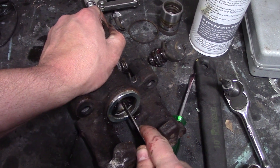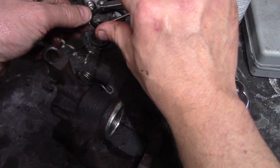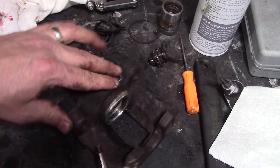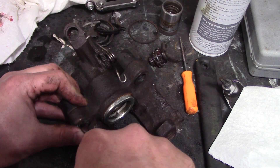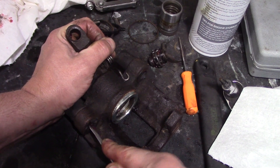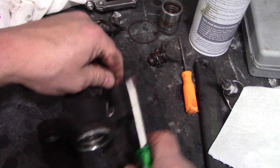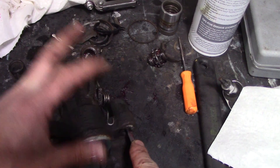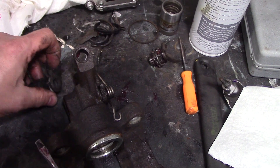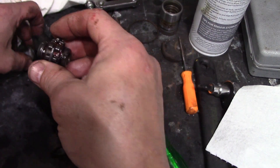Get the square seal out — there's a square seal; it's the only one in the brake cylinder, right there. You can also push out the boots for the caliper pins if you want. The easiest way to push them in and out is on the flange side — that's the toughest part of the rubber on these things. So let's clean this stuff up.